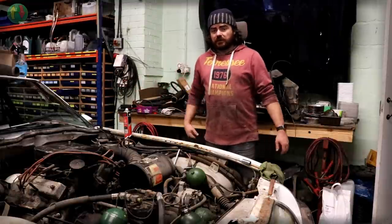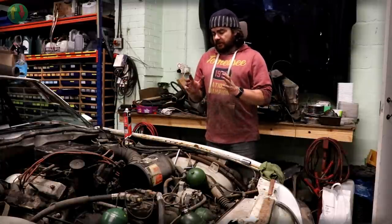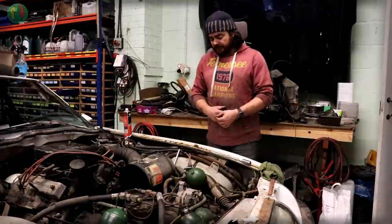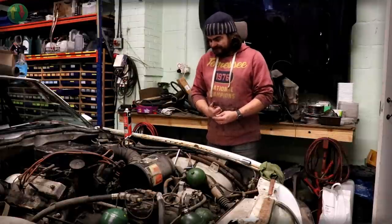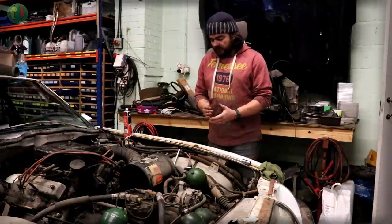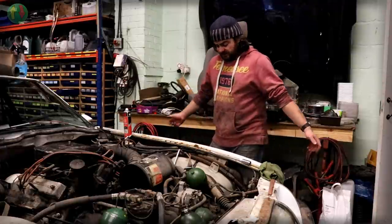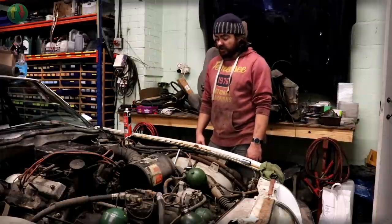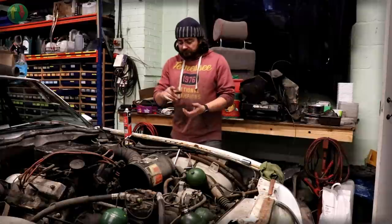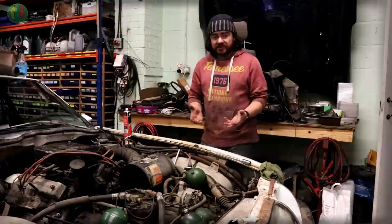Hello to you all, including all the new viewers who've come over. I've got a couple of minutes spare at the end of the day, so what I'm going to do is try and find out if the engine in the SM is completely ruined or not. It's perhaps a little optimistic to assume it might not be, but I don't actually know. I don't know why this car came off the road - it's a non-runner, it hasn't run for decades maybe. The last guy who had it couldn't get it running, and apparently he shouldn't have tried because of the valves. I filmed the other day and found out that the cam chain on the right-hand bank is still there, still in tension, and it looks quite nice inside.